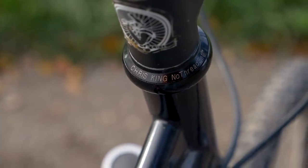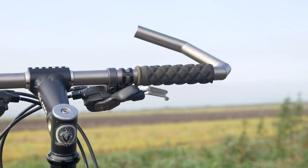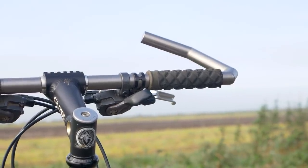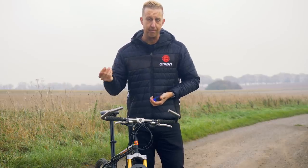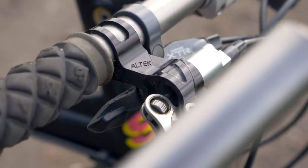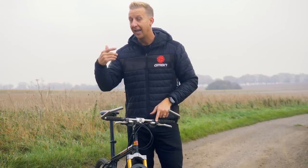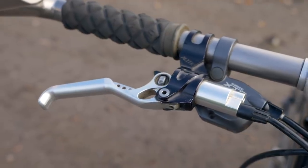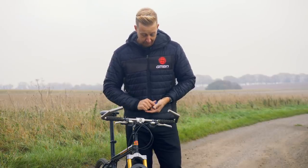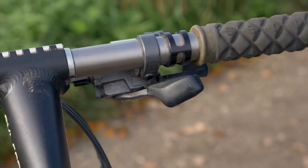There's also a classic Chris King no-threadset on the underneath. The grips are Surface grips — they've perished and gone hard now, but they used to be very soft. They're not lock-on, so you'd have used hairspray or paint to get them to stick — hairspray being essentially a minor lacquer or glue. The brake levers are something special: these are Ultec brake levers, retrofit levers for Magura HS33, HS11, and HS22 brakes. I've never seen these in the flesh, only in magazines. Full CNC-machined aftermarket levers for what was already an aftermarket product — a pretty cool piece of tech. There's also a set of XTR Rapidfire shifters neatly stashed under the bars, and they still look just as good now as they did back then.